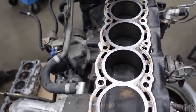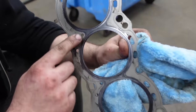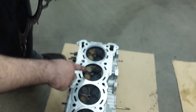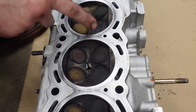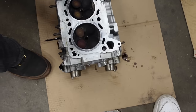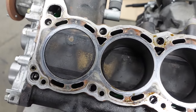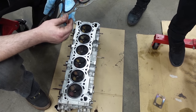The head is off the car, meaning the head gasket is off. Josh is inspecting it right now. This cylinder is a lot cleaner than the others — I can see it on the piston too. When you pressurize one, it blows out the other. You can tell which one had bad lash. The valves are filled with sodium — you have to be careful when you dispose of them. You can see how this piston is a little cleaner — that would be your cylinder five, which is where cylinder four was leaking into.